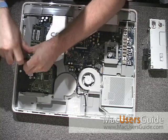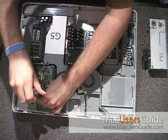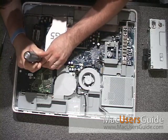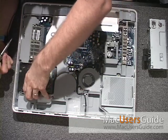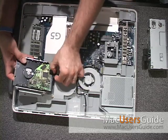Removing the hard drive is not too difficult. There are three main screws that you need to remove. Once the screws are removed, you'll see a little cable connector connected from the hard drive to the motherboard. You'll have to remove this by wedging your screwdriver again into the cable connector and slowly and gently rocking it loose. Don't do this too hard or you'll damage the cable connector. Next, remove the SATA connector and the power supply.